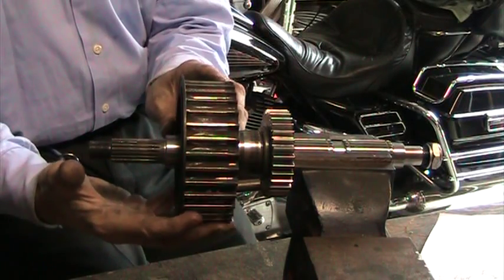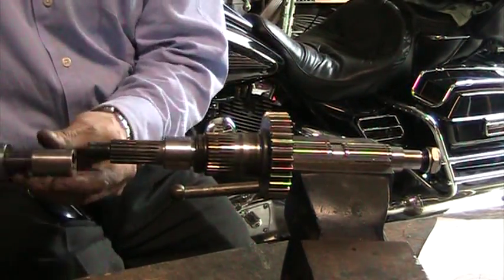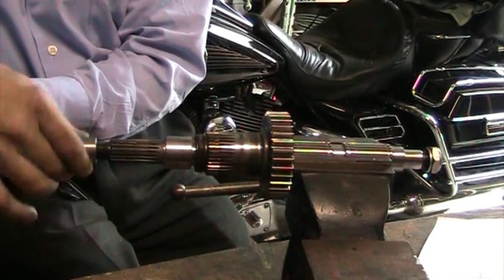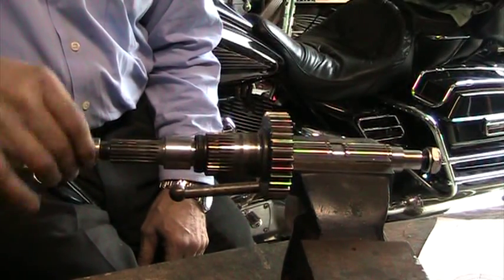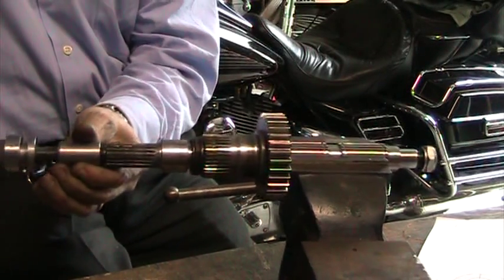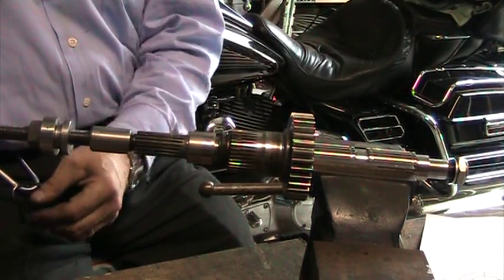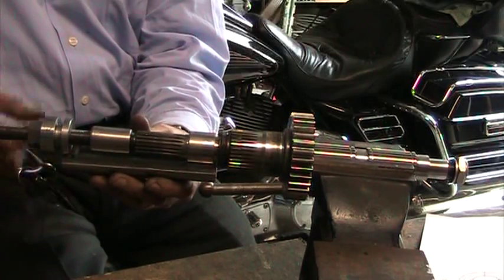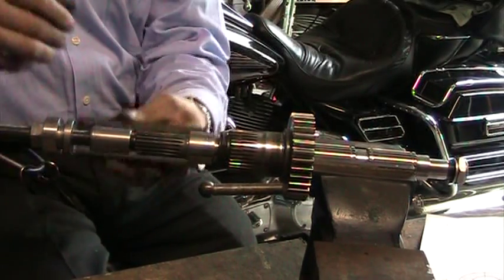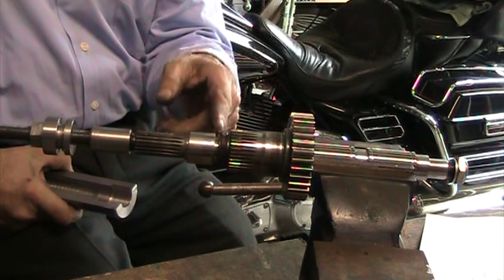You would install it just like you would any other tool — you just hook it here onto the shaft. It's counterclockwise, and this will be in two meshes. A nice feature is when you install the tool, it will have a preset of 100 thou, which is the tolerance recommended by Harley-Davidson.